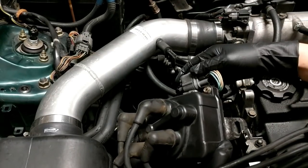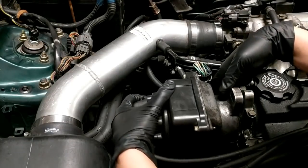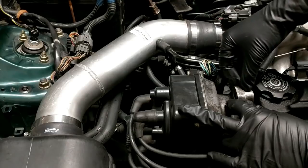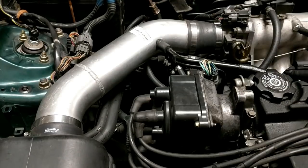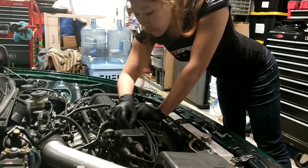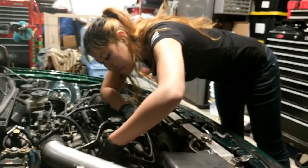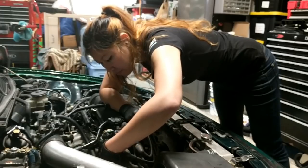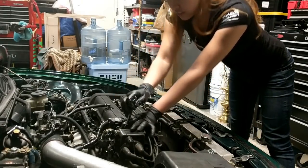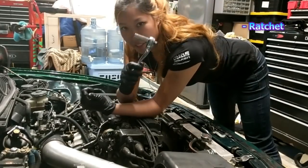You're going to put it back into that bracket and listen for that click, and then we're ready to put the distributor back on. You want to make sure that the line here is straight and aligned. Now I'm going to hand tighten the bolts in — one for the top and one for the bottom. Now we're going to use a 12mm wrench to tighten the top bolt, just making sure that it's snug, not too tight. And a 12mm deep socket to tighten the bottom one.